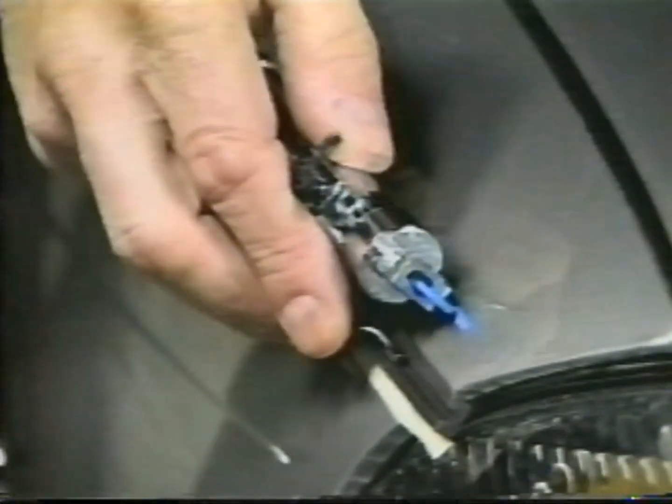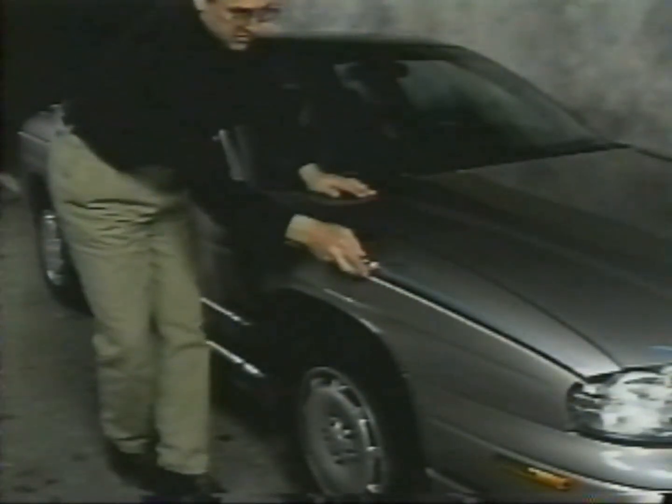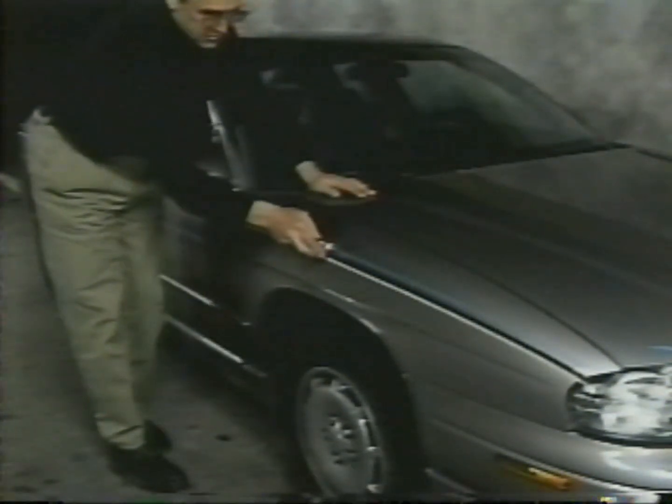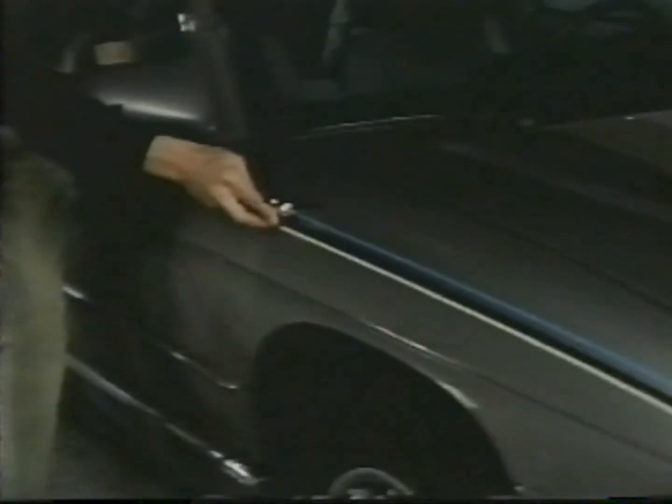Begin striping by placing the guide arm in position on the magnetic guide and the wheel flat onto the car's surface. Keep your arm extended in front of you. This will keep the tool parallel to the magnetic guide. Use your other hand to keep your balance.